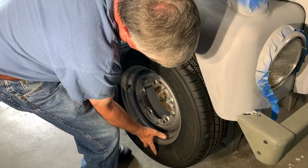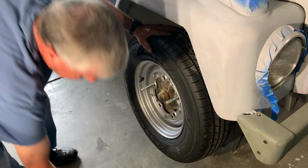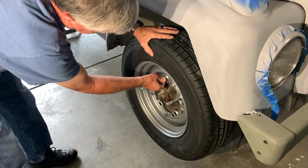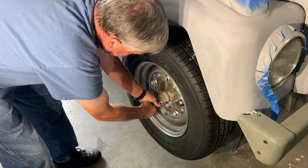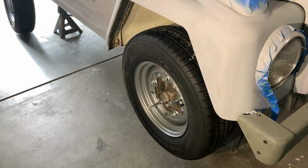Get it onto the pins. Slide the wheel on. Man, is that easy. And then go ahead and put your regular bolts in. So, just thread these back out again and put your regular bolts in, you're good to go. So anyway, wheel hangers, I'll see if I can put it in the description.